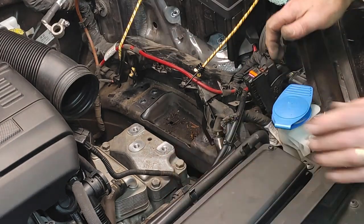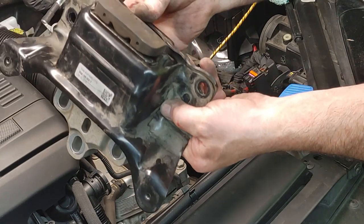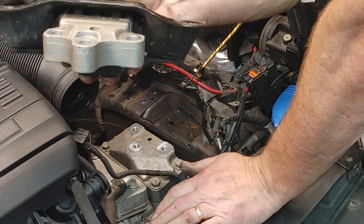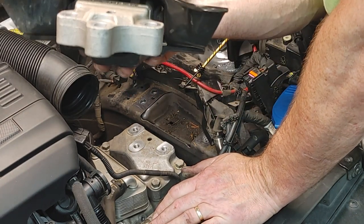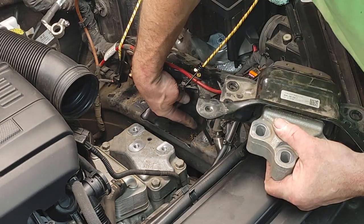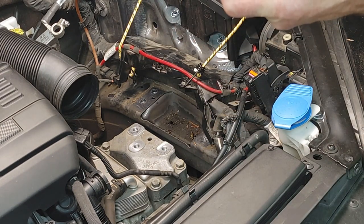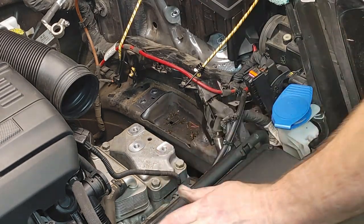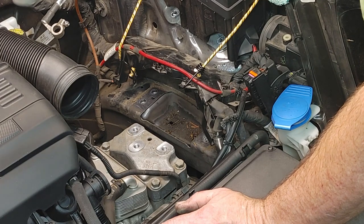And that appears to be, this is the one thing that I'm a little bit confused about. Some of these have hydraulic fluid in them, and I think I can say that this one does, because there's oil down in the bottom here. So when this failed, the hydraulic oil inside failed. Now I was trying to find the difference between them. It looks like Volkswagen makes a solid rubber, and then they also make a hydraulic filled one.